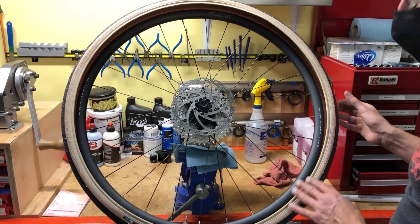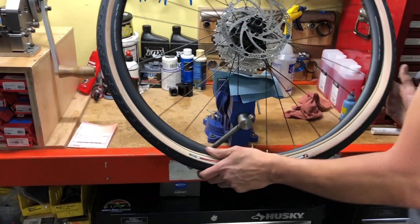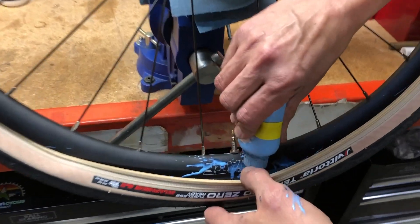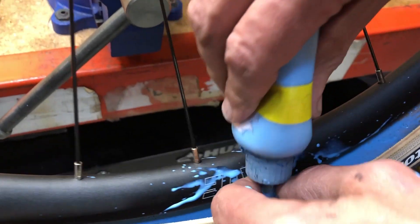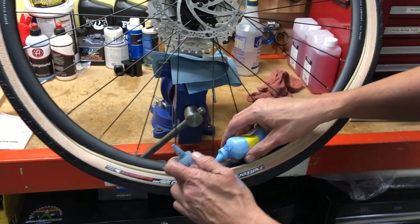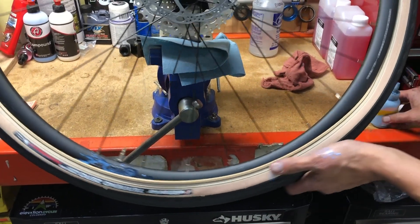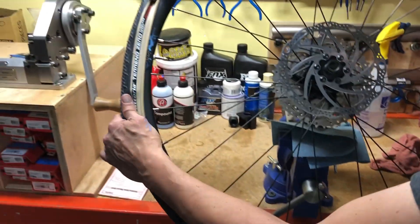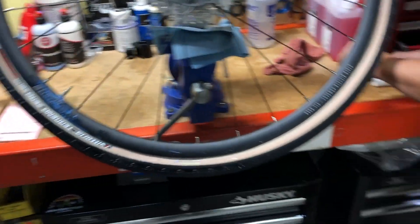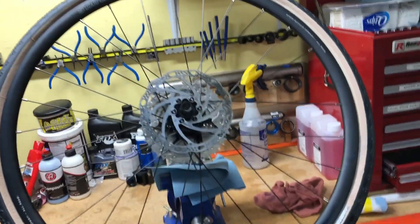I've got one side of the tire worked on with just this one last little gap. My tip was clogged up a little bit so I sprayed a little sealant everywhere. Depending on how well the tire fits — if you feel like it's going to be a really tight fit, I'll usually just do this method cause it's really quick. If you're unsure of the tire and rim combo, I'd get the tire on there, inflate it, make sure it locks into place, and then you can just pull the valve core out and squirt the sealant right into the valve core, which is definitely more of a safe bet. The way I just demonstrated is more of the fast production method.